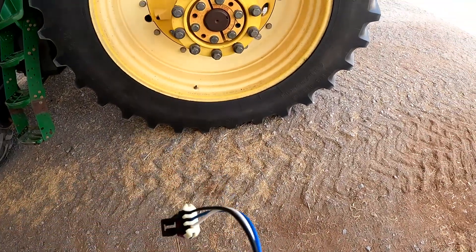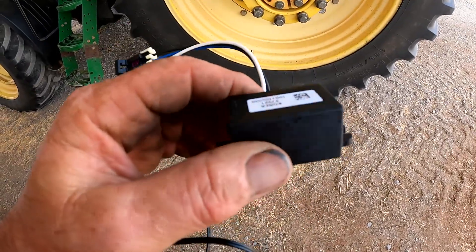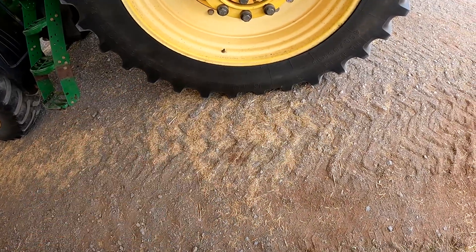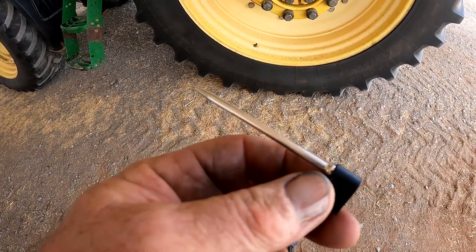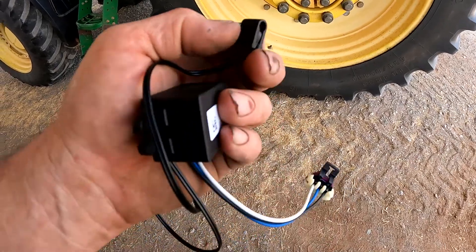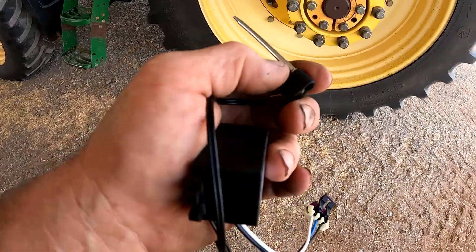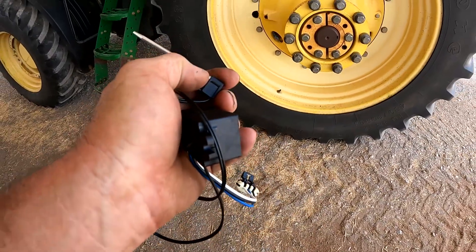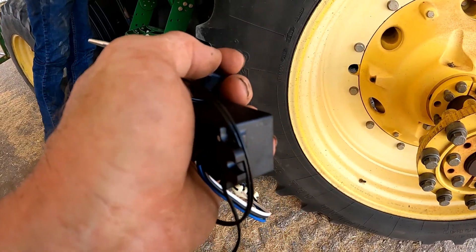Here's the new de-icing switch. It's got a little wiring harness that plugs in, plus a small module that mounts over by the evaporator inside the cab, and a capillary tube that plugs into the evaporator. All it really does is cycle the compressor on and off and de-ice the evaporator if it ever becomes iced over.